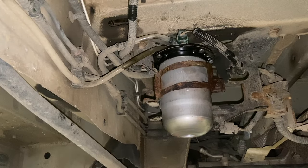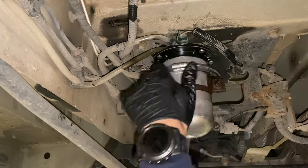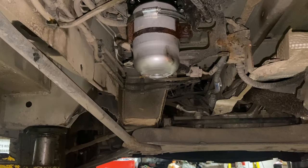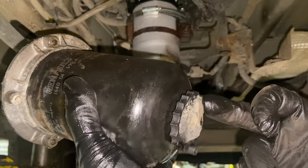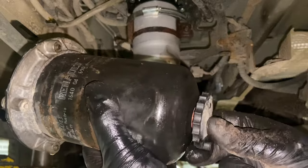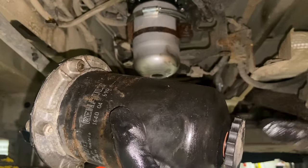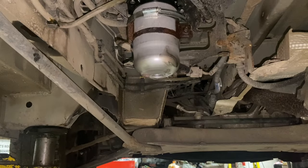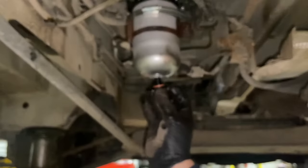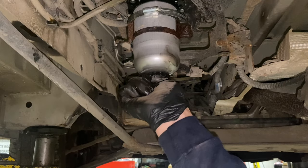Once we've put the jubilee clip on I'll give it all a good wash down with some brake cleaner, so when running it up you can check there are no fuel leaks. One important thing I nearly forgot — you've got to swap the cap over onto the new filter, because these aftermarket ones don't come with a cap on the bottom. Just simply unscrew this and screw it into the new housing. It's only plastic threads so don't do it too tight. When you undo the old one you will lose quite a lot of diesel out of the filter, so do that over a drainer. Thread that into your filter and it's just a good firm hand-tight nip.